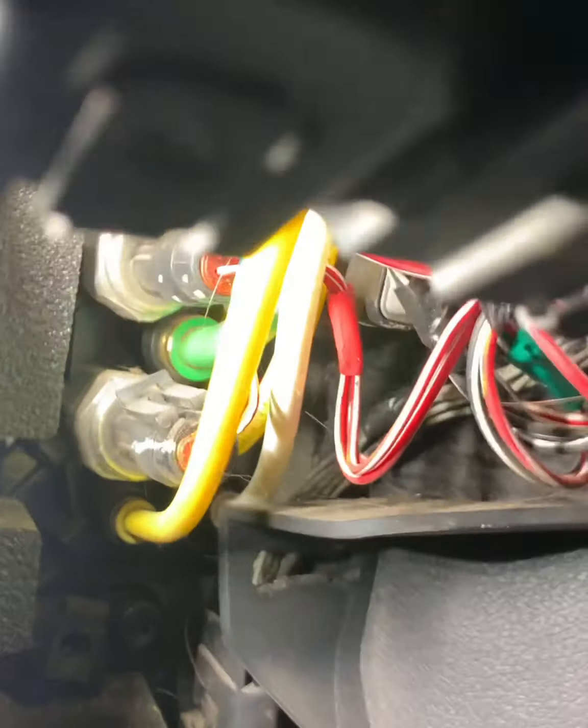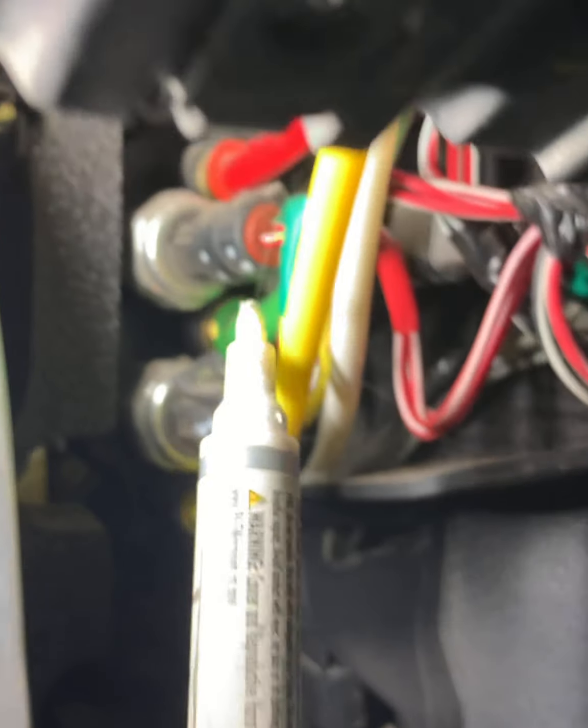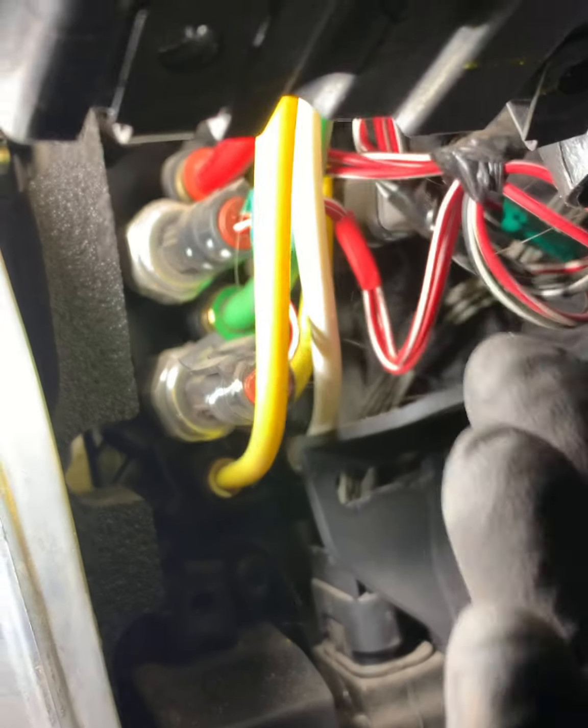So now we're off to do all the inside work. Now we're looking at all the pressure sensors. I like to mark them. That way I know which connectors go to which sensors in case they're not easy to see later. So I like to mark everything. If the lines aren't color-coded to the manifold itself, I like to mark the lines, you know, draw a specific number of stripes or dots, whatever it takes, really, and I'll take a picture to help.